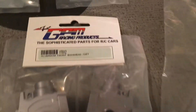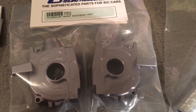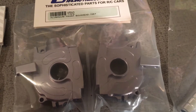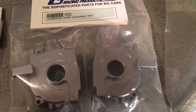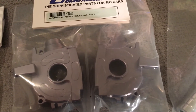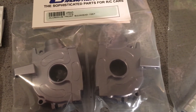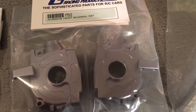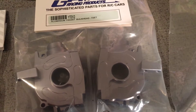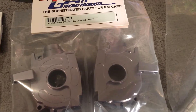Next, I have the GPM aluminum front bulkhead — basically the front gearbox. It assembles differently than the actual Axial plastic one. I've got two of these in my Axial XO and they're great. They keep the gear mesh between the pinion and the diff correct, and you just don't have to worry about the flex you get from the Axial plastics. One thing I noticed on both the XO and the Yeti XL is that the plastics flex, and I think it causes improper gear mesh — that's why you have so many gear problems in Axial high-speed vehicles.